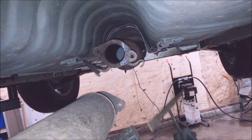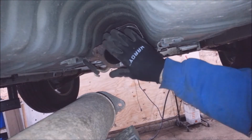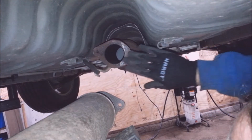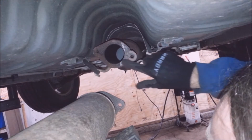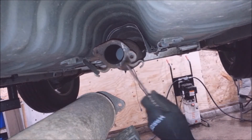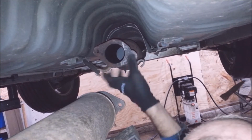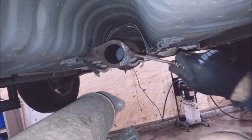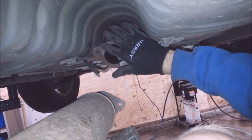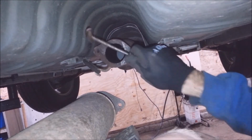The biggest reason why I like using a chipping hammer is because it's really hard to tell where the metal starts and the rust ends. Like I say, you can grind it too, but I just don't. I guess you could call it a stubborn preference. This is how I do it and it works fine. I think I got it all, and then I go whacking it more. There's more stuff flying off of it.